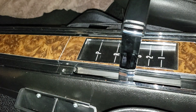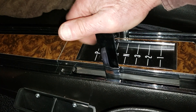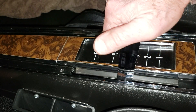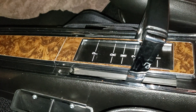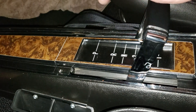We'll pull all the way back — there's overdrive, it's locked into overdrive. Got a lift to go to neutral and reverse like stock. There's overdrive. I can lift this handle, jerk it back, drop it — I'm in third gear. It will not go to second gear if you lift the handle like that and hold it to get into third gear.